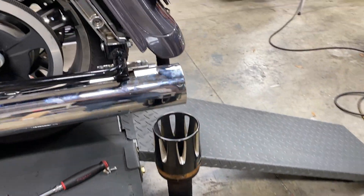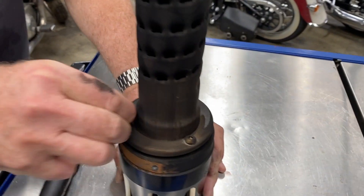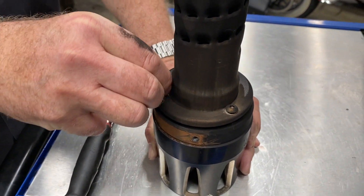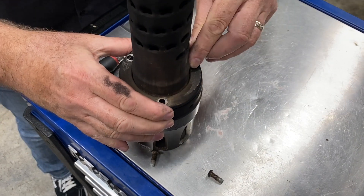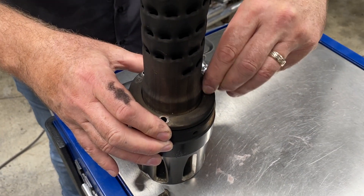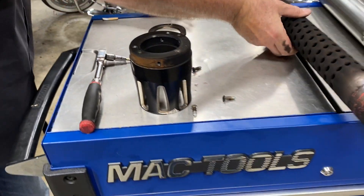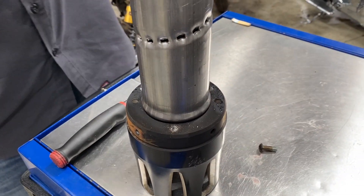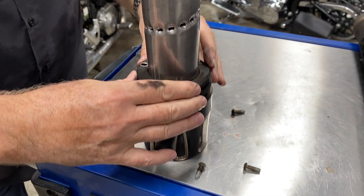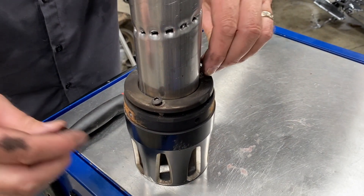They sound pretty good. Looks like we have done some curb scraping on this one as well. Here we're taking off the retaining ring that's screwed to the end cap — pre-loosened. They come off real easy. Just got that ring off. Put the new baffle in — this is so easy, very user-friendly. The Rinehart people were thinking like shade tree mechanics, which is good.